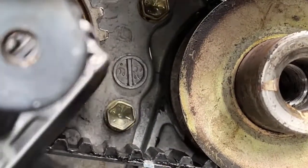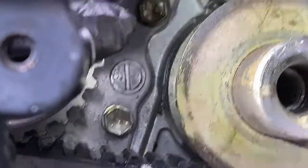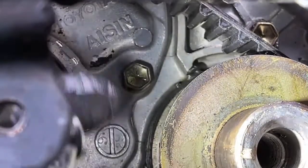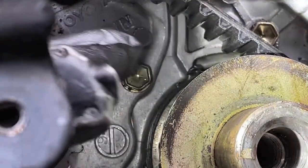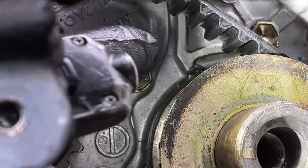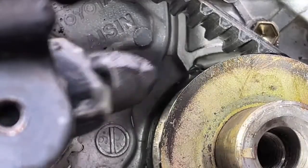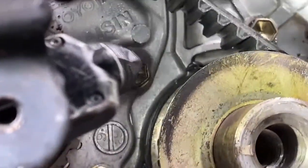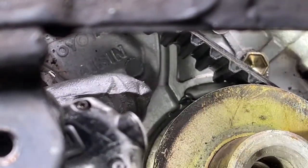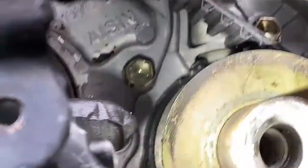And there. And there. Now again, they don't look like casting marks, but it's possible that they're just casting lines that are going in behind the gasket here, creating a compressed area of the gasket, and it's causing that to leak from these locations. However, from my perspective over here, they're starting to look like cracks. So we could probably seal those. I don't think they're under pressure.